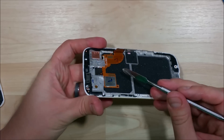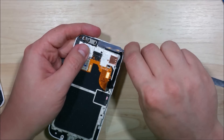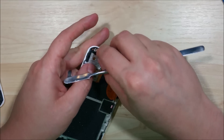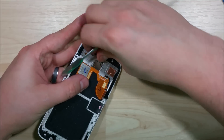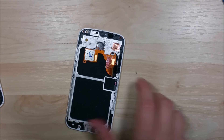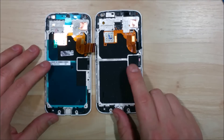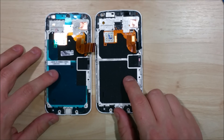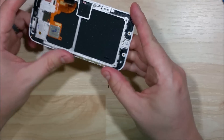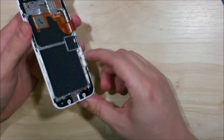Take a look to see if there's anything else to transfer. The earpiece speaker needs to pop out — use something pointed to help get it out, being careful not to rip it. You can use a little bit of heat here too if needed. It looks like we have everything needed to make the transfer, so this completes our disassembly. There will be more videos in the description if you'd like to check those out, covering moving the frame from the bezel and replacing glass only or as an assembly. If you liked the video, hit the like button and throw any questions in the comments.